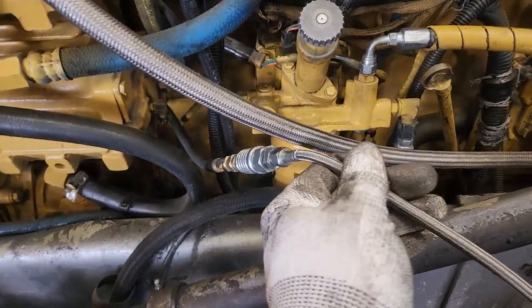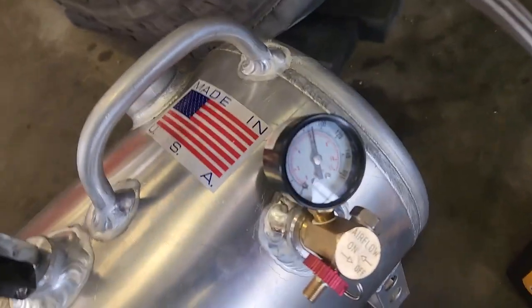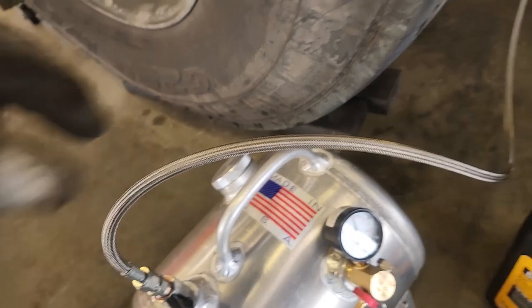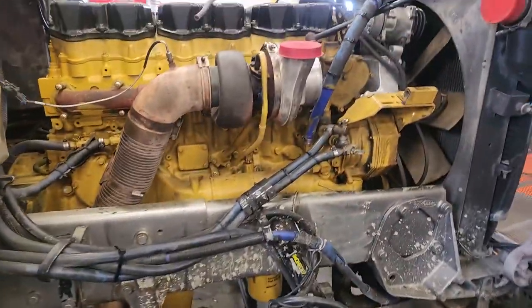For the oil system, I usually use the air compressor oil supply line, and then I use this All-Star tank that I really like — it'll fit two gallons. You just pressurize it and force clean engine oil into the engine under pressure before starting it up. I really like that tank — link will be in the description.